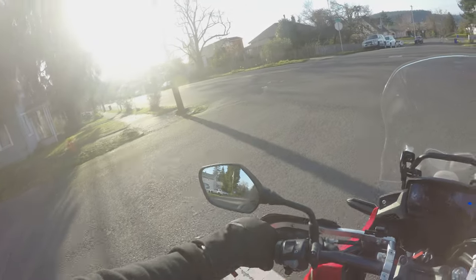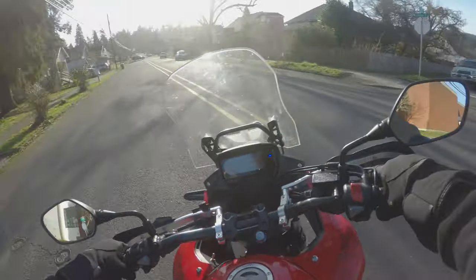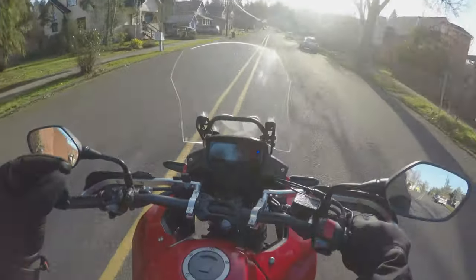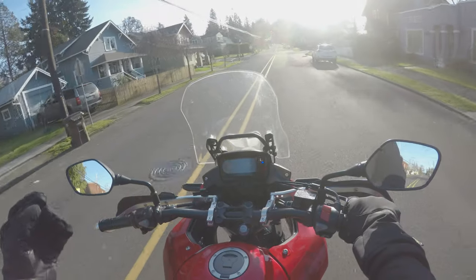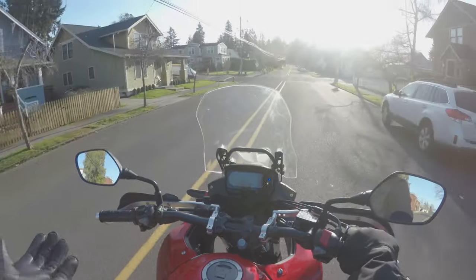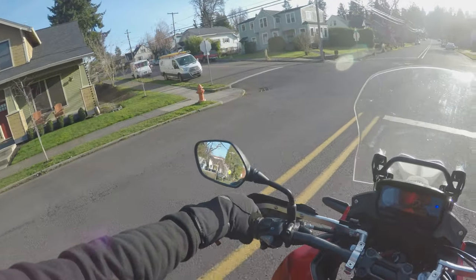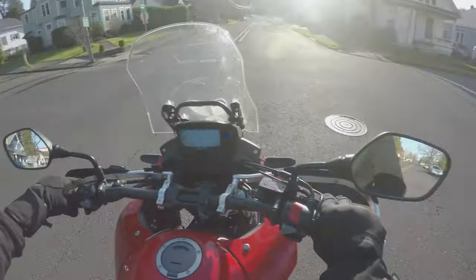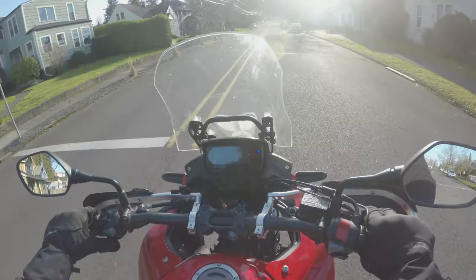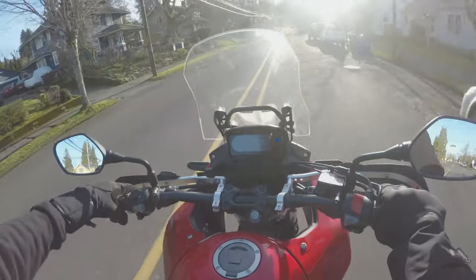If you look at it from a microscopic point of view, there are some rough surfaces, and those surfaces need to bed into each other in order to create the utmost in friction or surface area, whatever you want to call it. So right now with the new pads, there's not a complete surface area. Bedding makes them mate 100% or whatever you want to call it. There's no such thing as 100%, right?